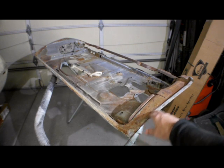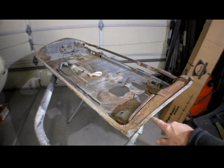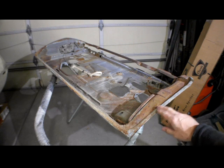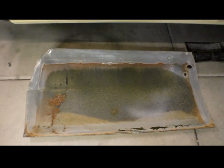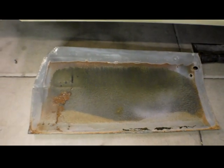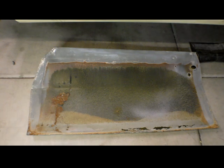Modern doors in your 2015 Corolla get panel bonding adhesive all along this flange and all the way around. And then I just kind of threw the old outer skin down here. No saving that thing now, or at least it'd be fairly difficult to do. Here we're looking at the spot welds that we're about to grind off.